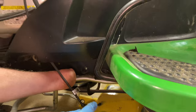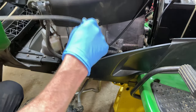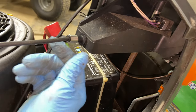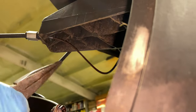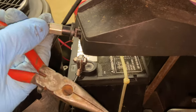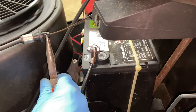At this point, you could take this cover off, but I think we can just pull it up through here. Now granted, our new one's going to have a spring on it and we'll have to fish it down through there, but I still think there's enough room. There's a little tab here and a tab here. When you put it in, the tabs open up so they actually hold it right there. So what you have to do is get behind here with your needle nose and push these in slightly, and then you can just pull it right out.